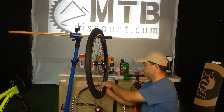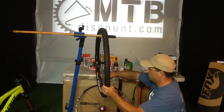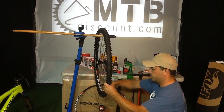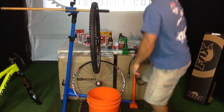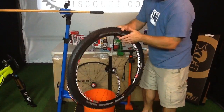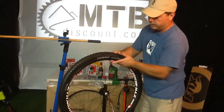We'll just bring it around here, keeping it all on the center channel so it beads up a little easier. It's always nice if you have a third hand to hold the tire for you. Just work the tire around until you get it all secured and dropped into the middle there. Basically the tire is set up in the middle — you kind of take it and roll it around and flatten it out. What that does is helps the bead start pushing out towards the sidewall, and you're also dispersing the sealant, so it'll make it a little bit easier for the tire to seal up.